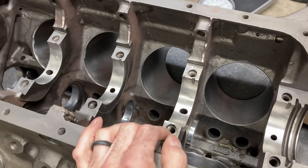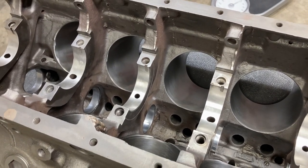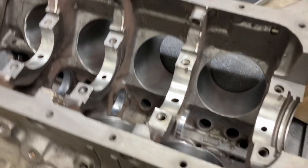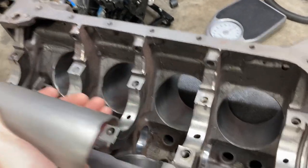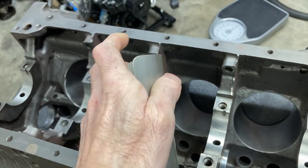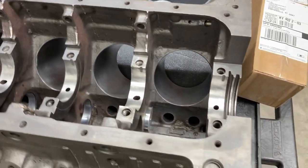I'm not at all concerned about the function of the cam tunnel. These have been used for decades and they are proven to make horsepower. I'm just planning to find a way to market this and make it easy for you guys. You're going to get a pre-shaped part made specifically for an FE block — it may need just a very fine bit of sanding on the edges to get it to fit your particular block, but this beats trying to whittle this stuff out yourself.